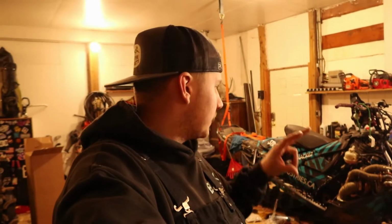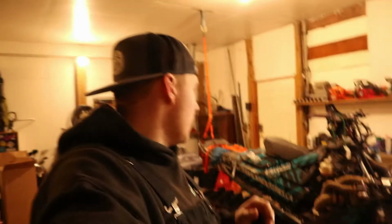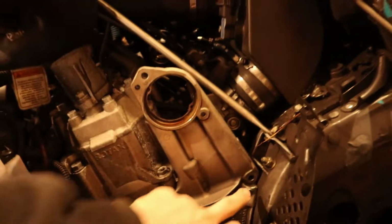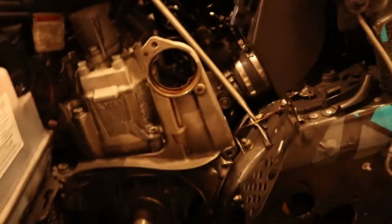Now we're doing a bunch of upgrades, so this will be an overview of everything we're going to be doing. For the specifics, we'll do individual videos. I had done a teardown video. Of course, we have this thing tore apart, the tracks out, the clutches are missing, the skid's on the ground. We went over everything to check it. So starting off, there's an M10 bolt right in here that fell out and went through our clutches. That's the basis of it. So this is what we're going to be doing.